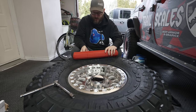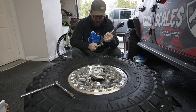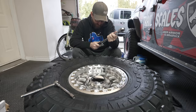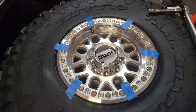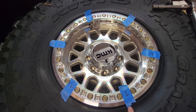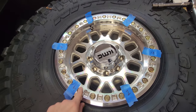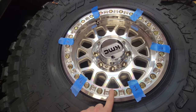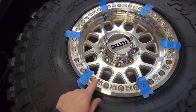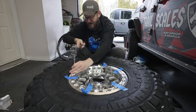I'm using my Tekton Amazon torque wrench — I've used it for several years. I was told to always leave it at zero when storing so it doesn't fatigue the internal springs. My trick for torquing beadlocks in a star pattern is putting pieces of tape on the wheel to track the corners, then going one through six on each bolt in sequence, which lets you keep track and achieve a very even torque pattern.